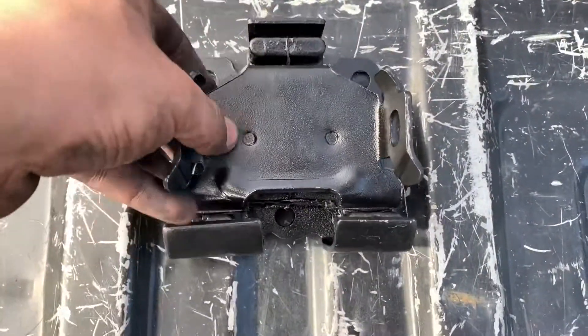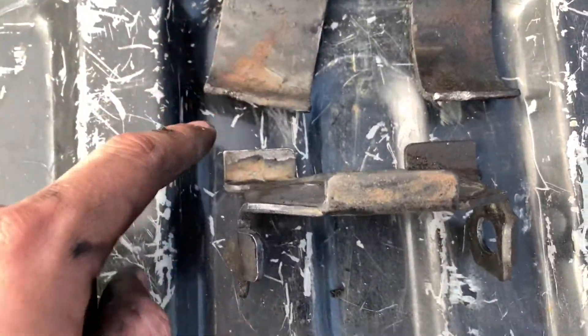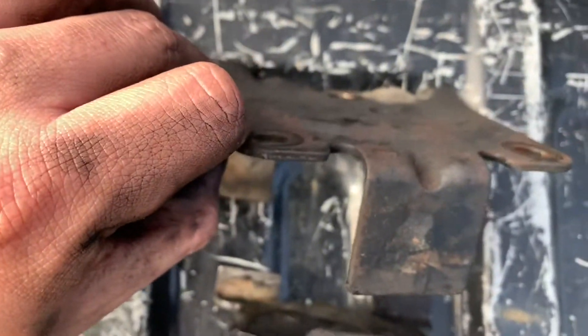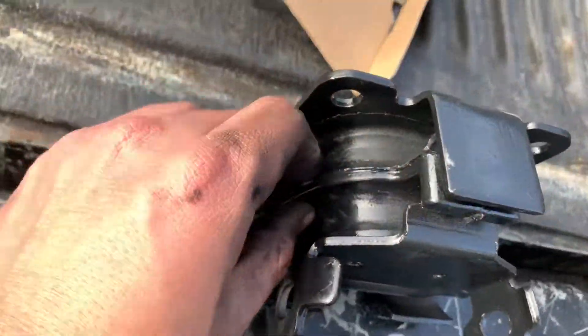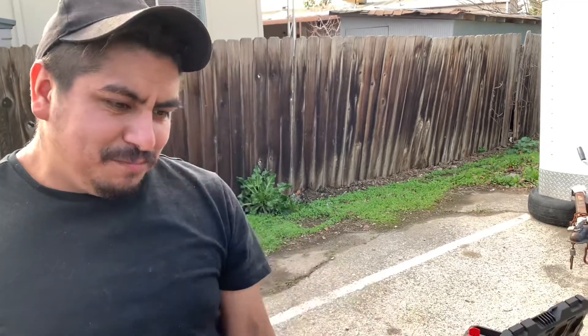So we were right - for the old one the rubber was missing. You can see the plate bent a little bit and it was scraping on the frame. This is how it's supposed to be, but there was no rubber in between, so the engine was just leaning this way and that's why everything was rubbing on the front. That rubber tends to just fail - S10 Blazers all run these, so make sure you're checking them.